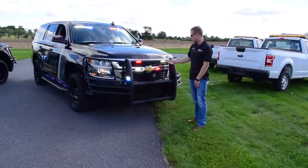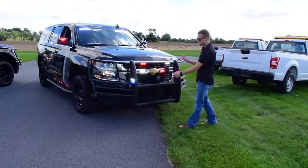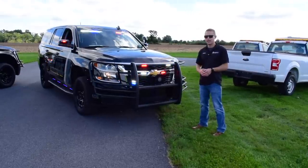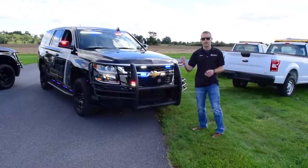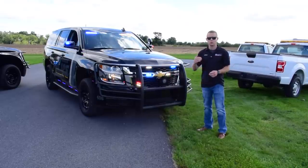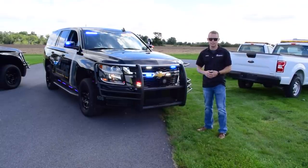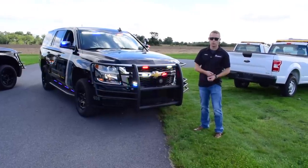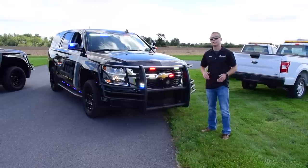We have Whelen Ion Duo red-white and blue-white alternating — four total, two blue-whites and two red-whites that X back and forth. This vehicle is Carbide with OBD-II pass-through, so we have an almost limitless feature set. Being Carbide, we can control mode one, two, and three all differently. So not only do you get your red-blue warning and red-white/blue-white flashing, we can actually override this to takedown — functionality you can only get with the Carbide system. Without it, this light is only dual-mode.